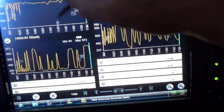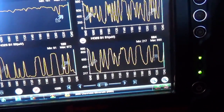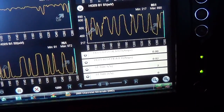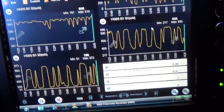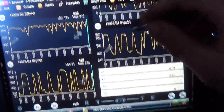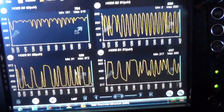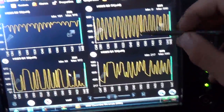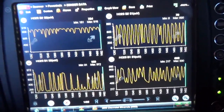Let's look at our fuel trims. Bank 2 - fuel trims are fine. The heater on bank 1 sensor 1 is just not operational. I don't know what the logic is behind setting the heater code - you'd think it would just measure continuity, but maybe it just looks at the warm-up time and compares the two sensors and whichever one's slower. In any case, it needs another oxygen sensor. That explains the low activity code - look at those signals. That's a sweet response versus a crappy one not dropping below 0.4 volts.